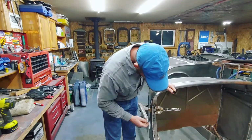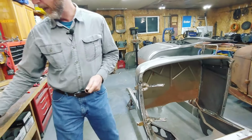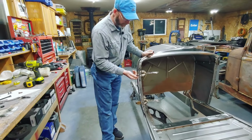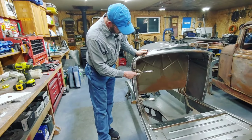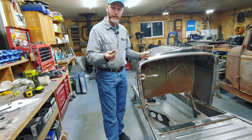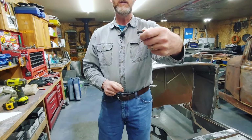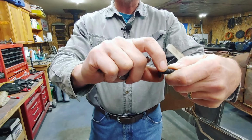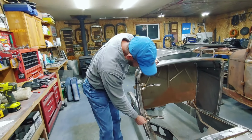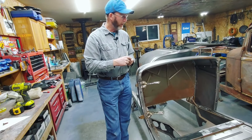So I'll start by probably drilling the first hole here and here, and then I'm actually going to tap it right on the car with my tap. Then there's a big countersink that I'll put in here with this countersink tool so that this washer right there will actually fit into the hole. Once that's set in place, then I'll do the two back holes, and then I'll repeat the same thing on the other side. So we'll carry on with this.